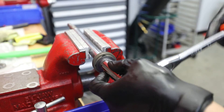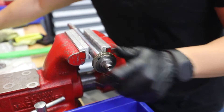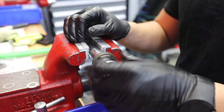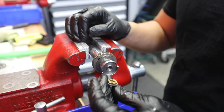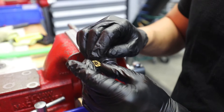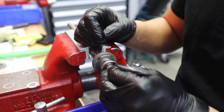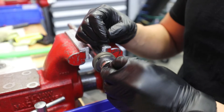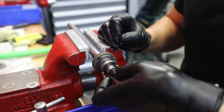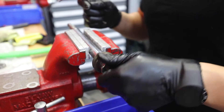I already know from doing the other one that I have to remove two of the spacers in the rear so that I have the correct amount of preload. I'm going to tighten this up. Next thing — throw this back on. We're going to go back here and make sure there's no major grooving between the slots, because if there's any grooving you're not going to get a good click when you're adjusting your rebound. Nothing's more satisfying than a good click on your rebound. Tighten this up, but don't tighten it too tight because it's just brass. It spins freely — everything's good.